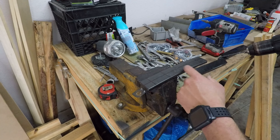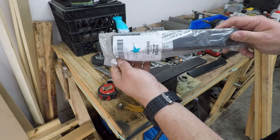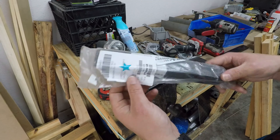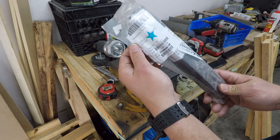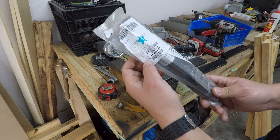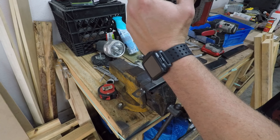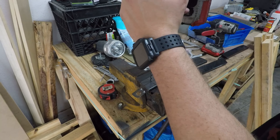Some cutting lubricant would help this process. These are getting painted afterwards to match his truck — that's red — so I'm not worried about taping anything off. When I did mine, I bought these grill filler panels — right hand and left hand, 96 to 02 4Runner, made in Taiwan. I'll link these in the description along with a link to the lights and everything. Pretty much all I'm gonna do is drill a starter hole for the step bit.